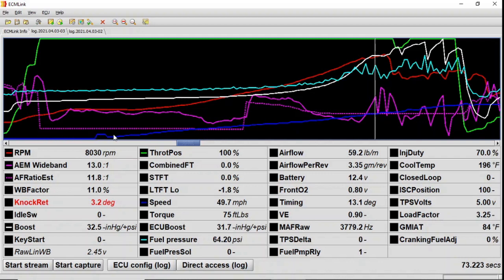This portion right here with the dotted line down here, my air fuel ratio estimate, this is my target for my nitrous, of course. I'm not dialed in here. Nitrous wasn't turned on anyway in this regard because I was going leaner than what I was targeting, so that's not really a big deal. That's something I wanted to dial in before I actually start spraying.